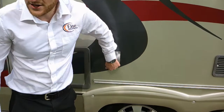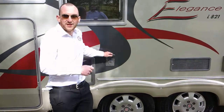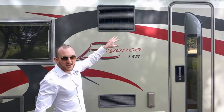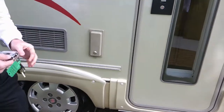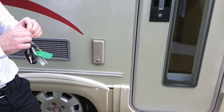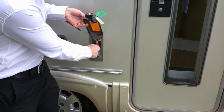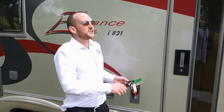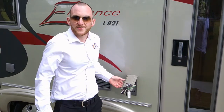Just a bit further along we have another external shower point — presumably the previous owner wanted one on either side of the vehicle. The rectangular vents are the gas vents for your fridge. There is also quite a nice feature: you have a gas barbecue point. There is a small silver key to unlock it. You have your barbecue point here and your on/off valve here, and this is all regulated at your gas locker, so you don't need to carry a separate regulator. You can simply connect direct into the side of the vehicle.